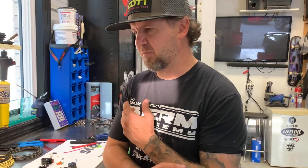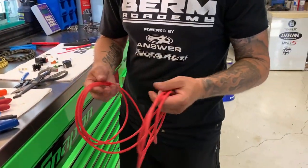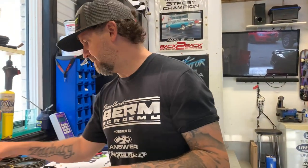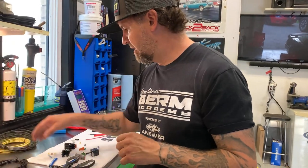In these boats we're not sending signals through, they're pretty archaic. Anything from TXL level or better. Some boats we wire we use all tefzel because the owner wanted the best. Long and short — buy the best stuff that you can buy. Buy the best connectors, buy the best wire. It's going to make a nicer, more reliable job that lasts longer. But do you need to have it? No. If you can't afford it, should you not wire your boat? No — just buy the best you can. If you can't find it, call me, I can help. I have Mercury factory colors in stock.